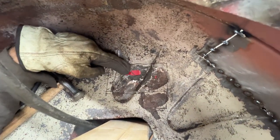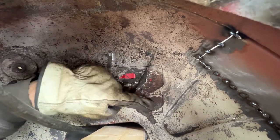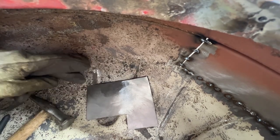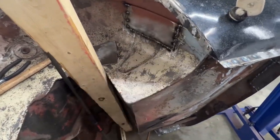The main problems are here, here, here, here, and here — this one hasn't gone through yet but it's gonna go through soon so we better change it now. I cut this piece, bent it more or less how it's gonna be, and now we're gonna mark these two lines and run it on the bead roller. We need to match these lines well — and if we don't, we'll have to flatten it and start again, because these two lines need to match perfectly. Two lines means we have to match them both, so it's gonna be trickier than normal.